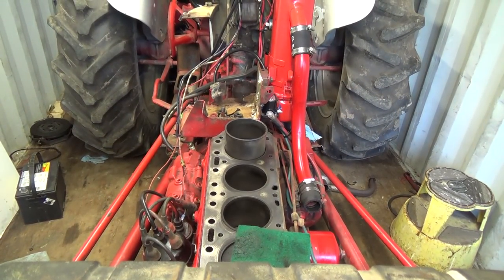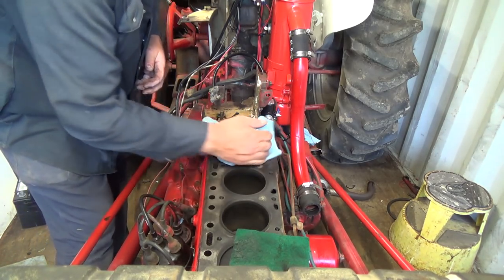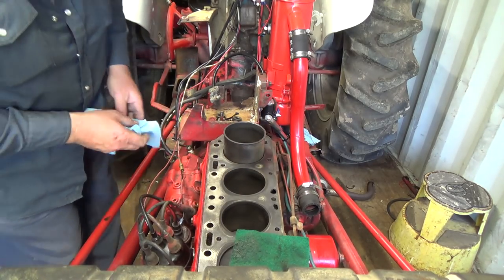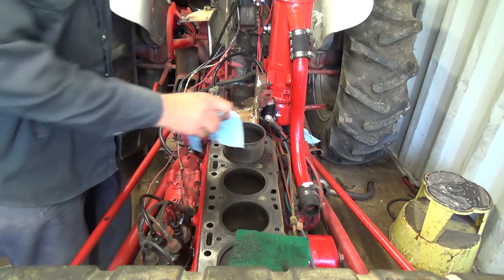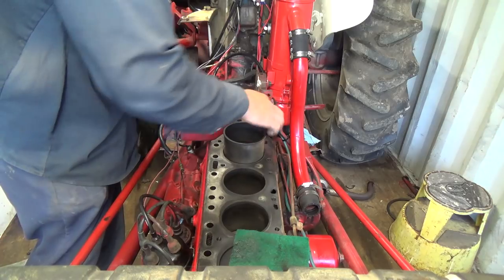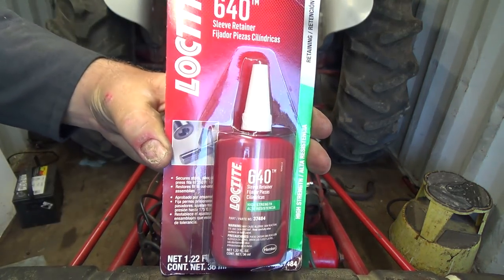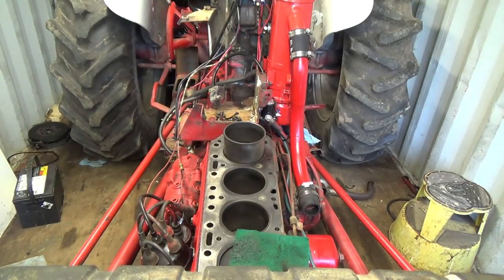I got this sleeve pretty much cleaned up. I'm going to work with a bunch of brake cleaner — it's dirty down into the bore, but there's not much I can do about down there. So I pull the sleeve out, and then I've got to take the whole bottom end off because you'd never get that sleeve back in there — they're supposed to go from the top down. What I'm going to try is get some air, clean out around where this little lip goes in. I've got some of this sleeve retainer stuff from Loctite — we're going to try and hopefully it will do its job.